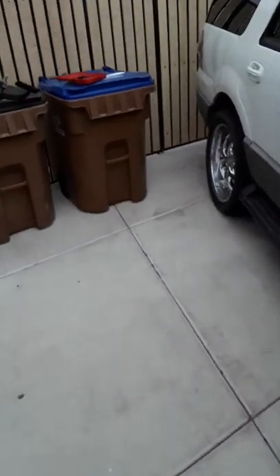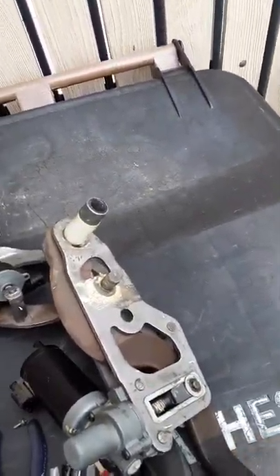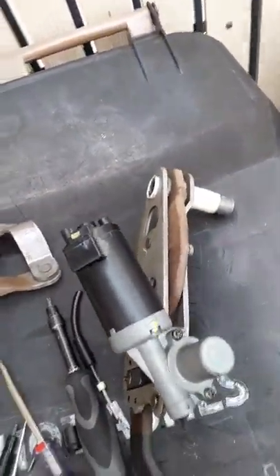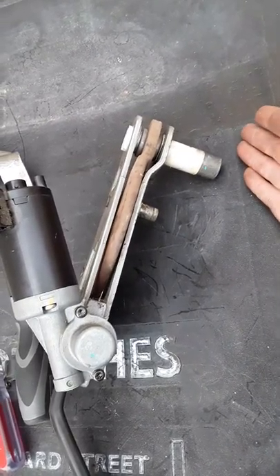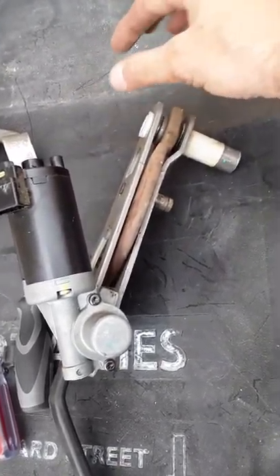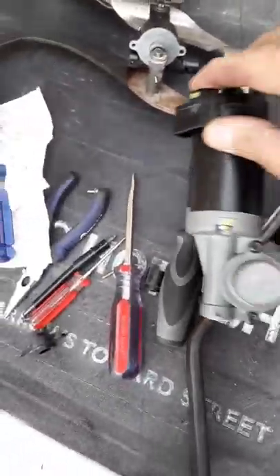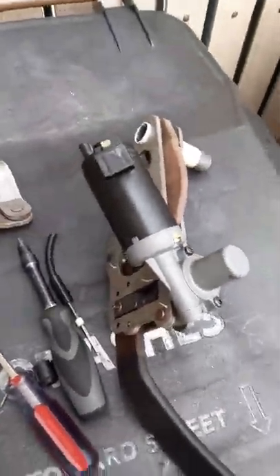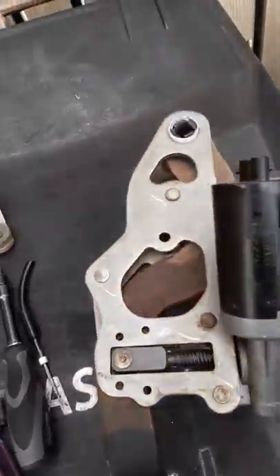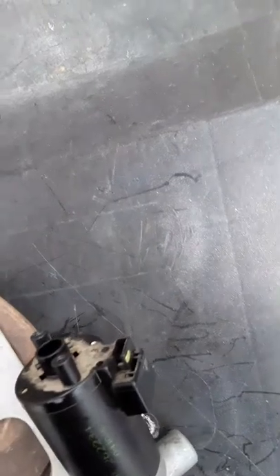Now, there's an easy way of doing it. On the brake pedal, this brake pedal sits up there and it's kind of a pain to get to, but it's going to save you hours of time. There's a bolt that goes through here, there's a nut over here and the bolt's over here, so you're going to have to get a socket on this side, a wrench on this side, and unbolt the bolt so it drops down. Make sure you unplug this plug here. If you want to do it the easy way and leave the cable up there, you can basically unscrew these two screws, twist the thing, and the actual cable will come right out.